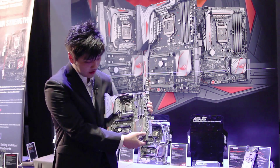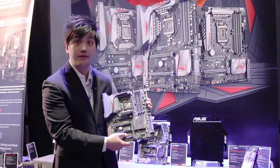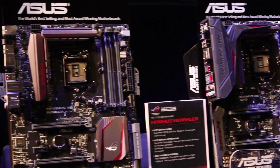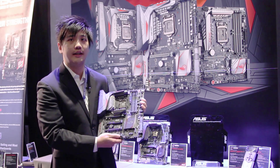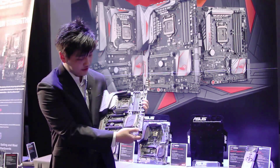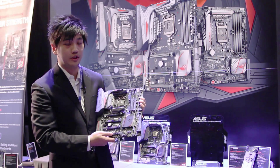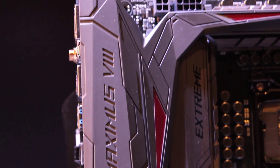On board, you'll see right away, all motherboards will support the M.2 specification from 2242 to 22110 in PCI Gen 3 x4 mode and also SATA mode. Additionally, you'll see only on the Xtreme this time, the U.2 onboard connectivity which also operates in PCI Gen 3 x4 mode.